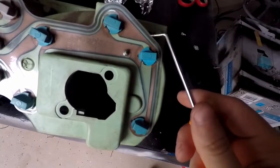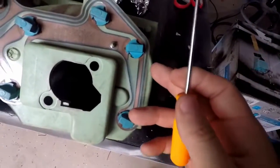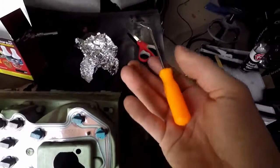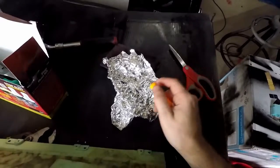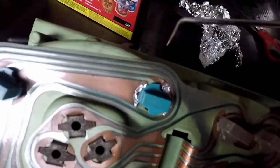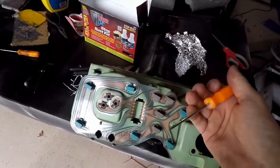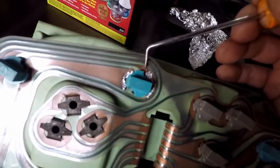But since this is on the tip, we have to get a little more creative — see what we can do. So I did some research: you can buy copper foil tape, which is essentially what these strips are, and just re-stick a new piece on, glue the plastic down, and you're good. They're not expensive, they're really cheap, but I don't have any in stock near me and I wanted to see what else I could use. Well, aluminum foil is conductive. This is very low voltage, low current — especially because it's LEDs. If I just shove some aluminum foil in there, well there's my conductivity. And I tested it out and it actually does work. Kind of wild, kind of crazy.